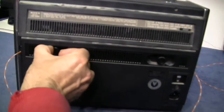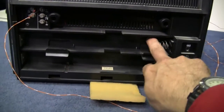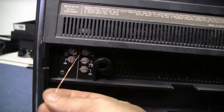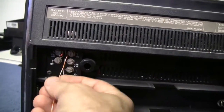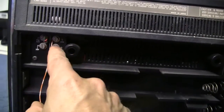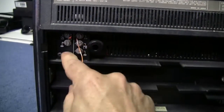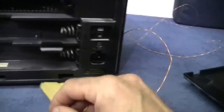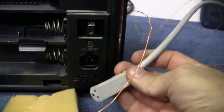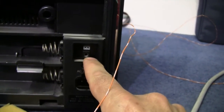These are interesting — pull these little knobs out, or little tabs, and that reveals your space for eight D-cell batteries. I wonder what this piece of wire was. This is for attaching more antennas, more aerials: medium wave, long wave, short wave, FM. That will be connected to the rod antenna on the top there, and a couple of earths. And this very strange Sony 3-pin, 6-amp socket, and a cassette output if you want to record anything.